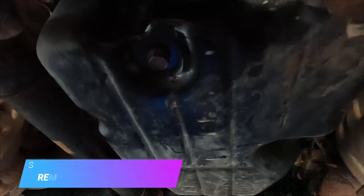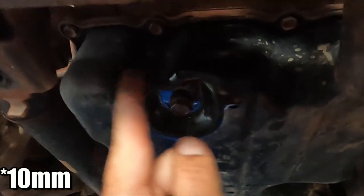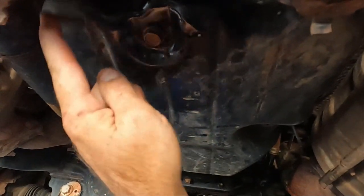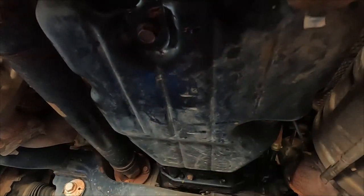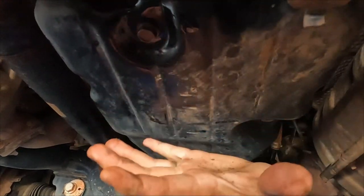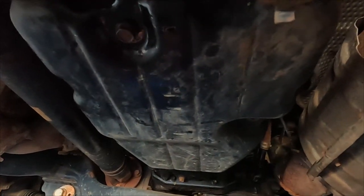The pan's been drained. Now we've got 12 mil headed bolts to take out so we can pull the pan down. There's always some oil left in there — what you need to do is work your way around so it drops down gradually and you can catch it, rather than pulling the pan off in one hit. Loosen the ones at the back last, and the pan should fall down so you can catch the oil without splashing.